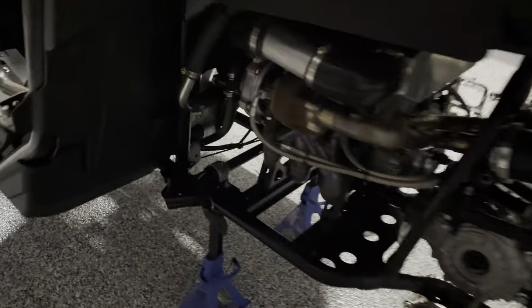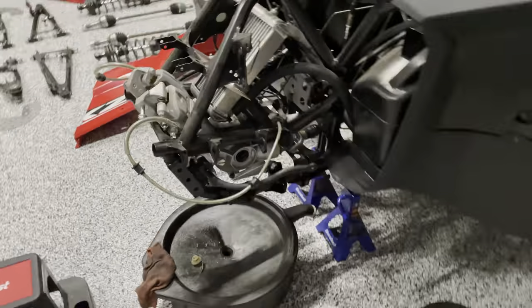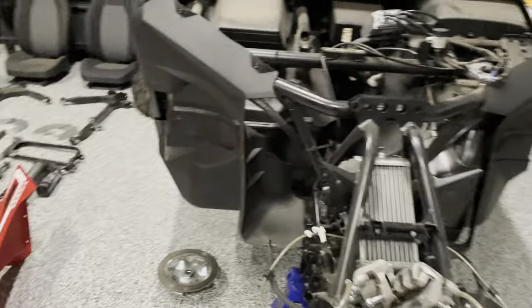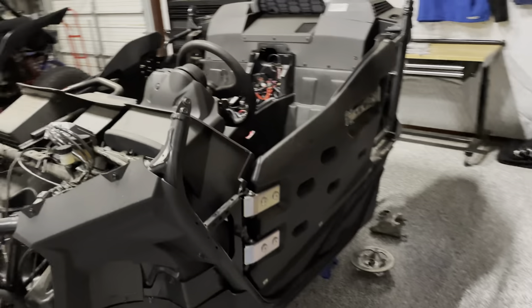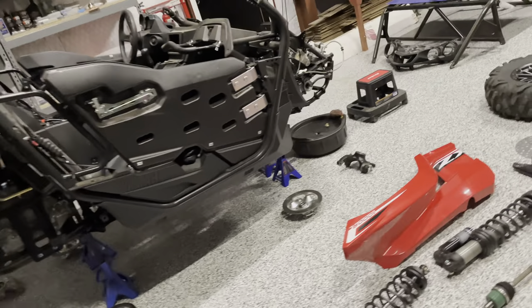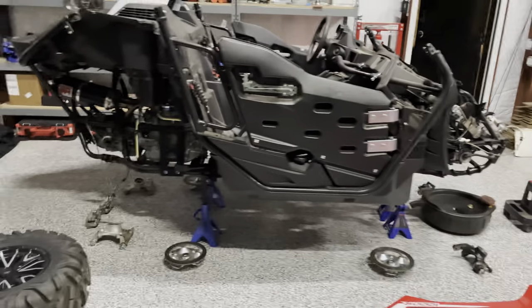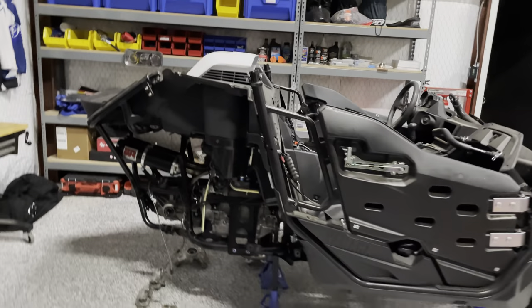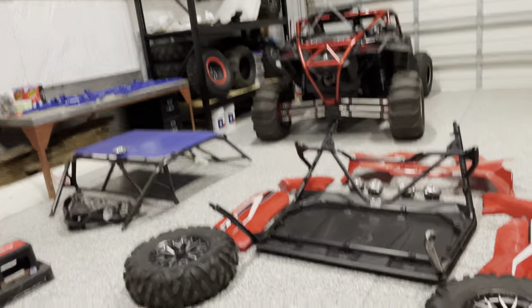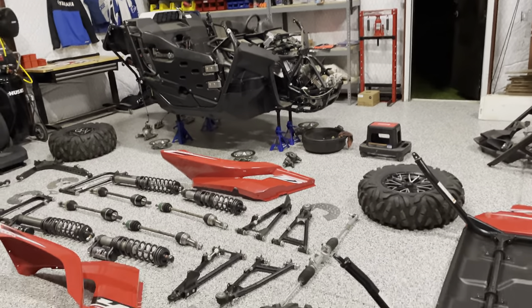I'm going to leave the factory sway bar in the rear, but I'll probably experiment with no sway bar up front — it's still installed but I'm going to try removing it. I hate body roll and I'm usually a big fan of sway bars. On my first YXZ I had the Eibach anti-sway bars, which are quite a bit stiffer with two adjustable settings, but they turned out to be too stiff for the sand. You really want long travel to work for you, especially doing transitions over an angle — the low-side arms need to reach down while the high-side arms are pushed up. On Brooklyn's car I've left the factory sway bars and it feels smoother overall.